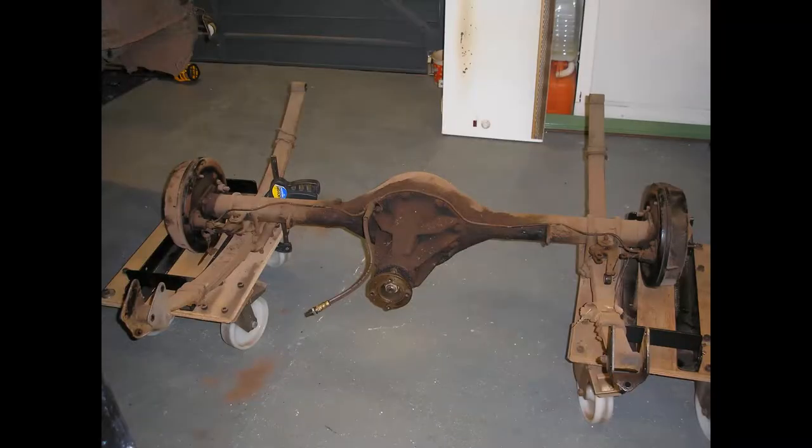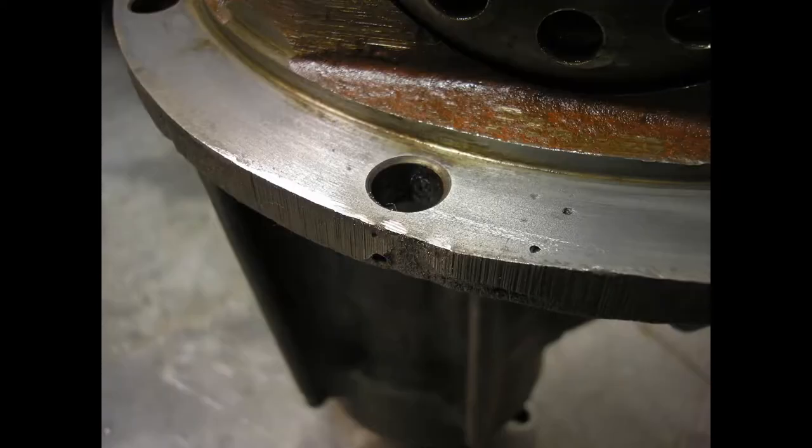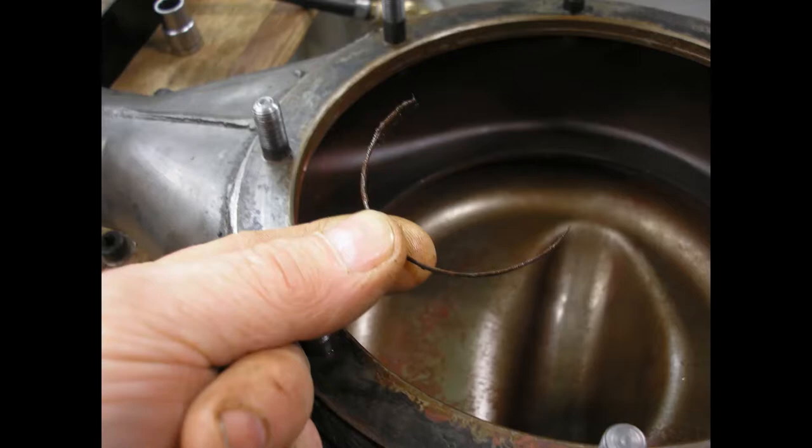These pictures were taken about 2009, or just before, when I decided to do the underbody. Here I'm removing the flange so I can put a new seal in there. The first thing I noticed when I took the diff off was bruise marks - quite a few around the diameter there. That was easily fixed by getting a fine file and then finishing off with a very fine stone.